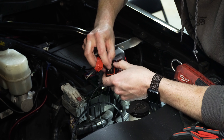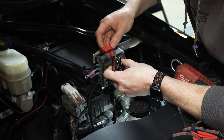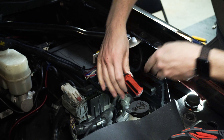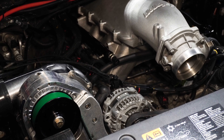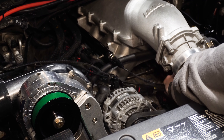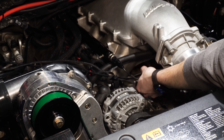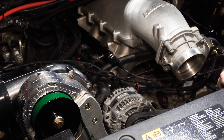We'll put our comb back on. We've got two pins trying to sit in the same slot — there we go. Pop it back on and plug her back in. Perfect. Now we've got to look at our fuel pressure sensor. Here's the loom that we just built in. Looks like we got everything perfectly long enough, plugged in. We can bundle all these together, keep them nice and clean, zip-tied up out of the way when we're all done. Now let's dive into the configuration and then we'll test it out.